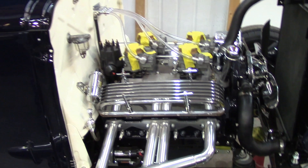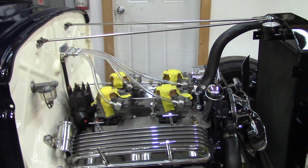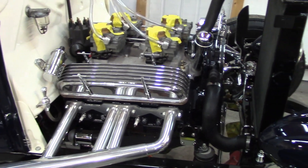I always run water when I first fire them up — no antifreeze right away, just in case there's a leak. I need to get some oil in there once the pan's on, and I put a little fluid in the torque converter before I put it together. I won't add any final fluids until I'm ready to start it. I still need a battery, some gas, and to hook the power up and get fuel up to everything. Brakes aren't leaking, differentials are full and not leaking, so hopefully no gas, oil, or tranny leaks — it's all new so I think we're good.